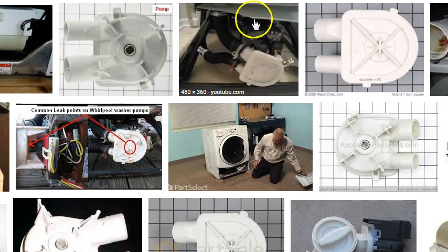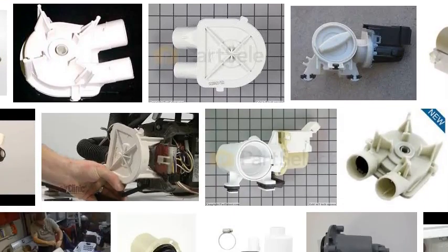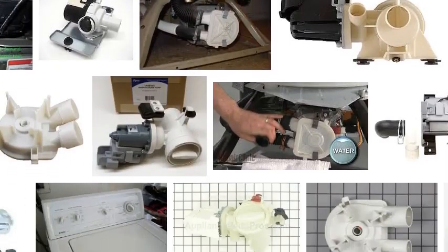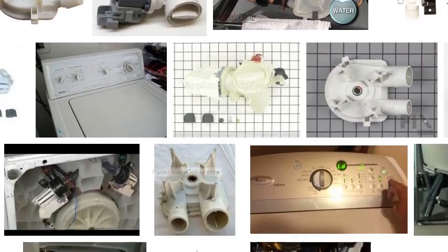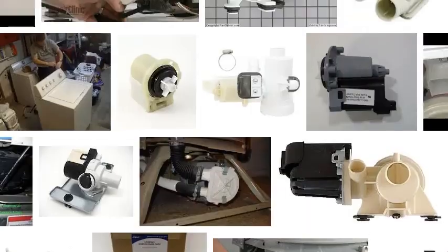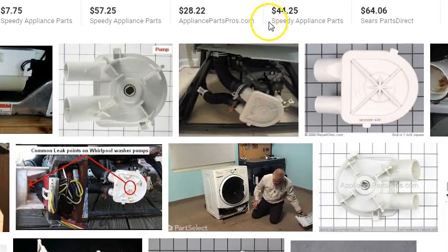What happens in these machines is when it's washing, the pump is going in reverse to hold the water in, and when it changes to the spin cycle, it reverses to pump the water out. In most cases when a washing machine pump gets blocked up, you typically have a situation where an article of clothing has crossed over the top of the tub between the inner and outer tub — and generally it's baby socks, small socks that get stuck in the pump.